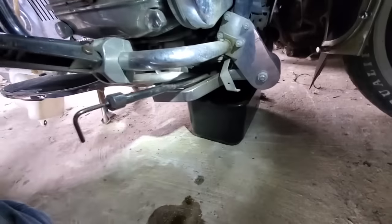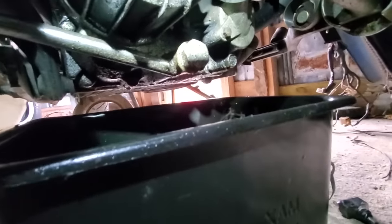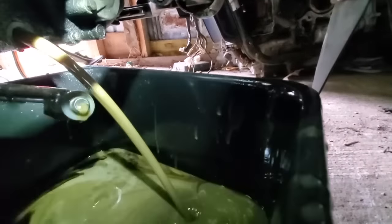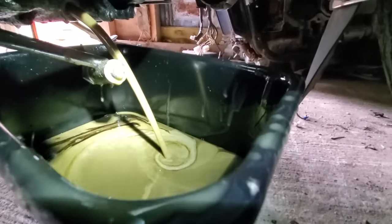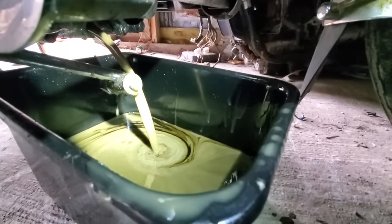So here is this dipstick, and it's attached right to where the drain plug is. Right through there, right there. What kind of nonsense is that? So you're gonna pull that drain plug out, eliminate that dipstick, the oil filter's inside of there, get all that replaced. All right, look at that oil. Yeah, that stuff's pretty bad. Very, very milky with water. It's not antifreeze, I don't think, because our antifreeze is full. Definitely need to get that out of there.